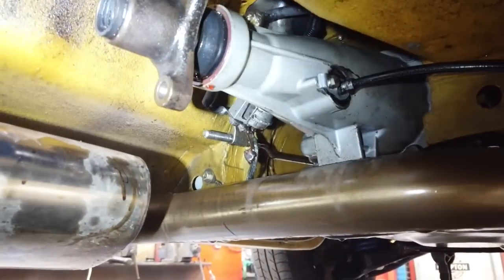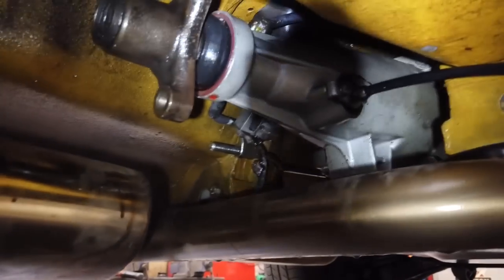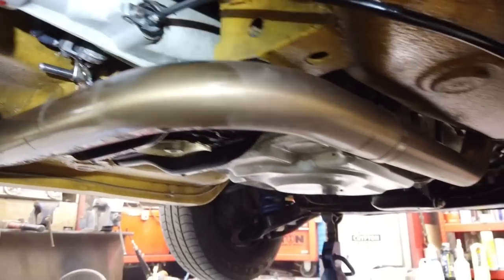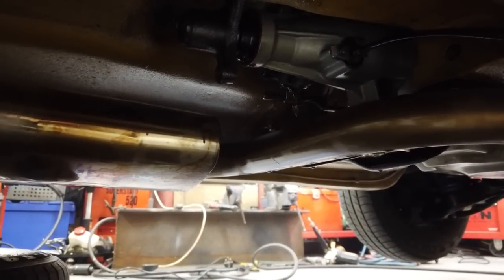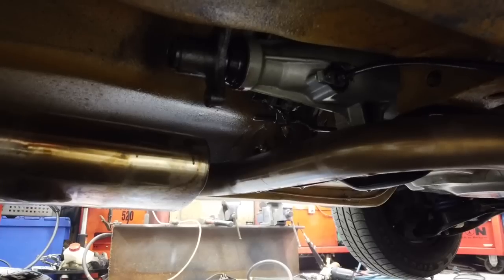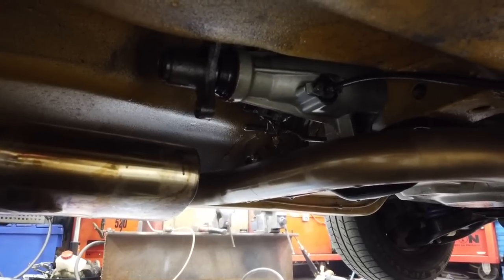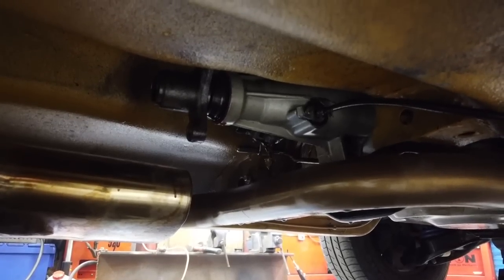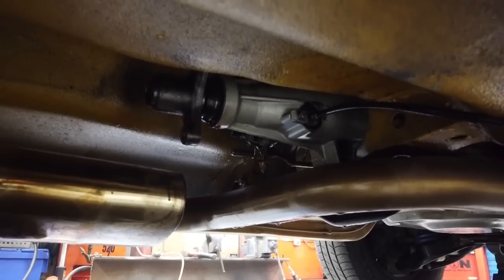If I get my glasses right, again, difficult to see, but here we are. And the mounts are under there, holding the gearbox up. And they're custom-made mounts. So the whole geometry on this was altered. When I made the mounts, I did mock them up with the angle of the front pulley relative to the car in mind, and indeed you could cross check that by placing the fan pump on the water pump onto the engine block, putting your radiator in and just mocking it up, and you should have a parallel distance of the fan and the radiator. If your engine was tilted too far down, you would start to crash your fan blades into the radiator.